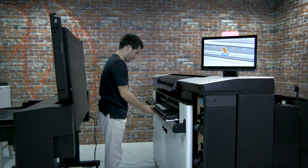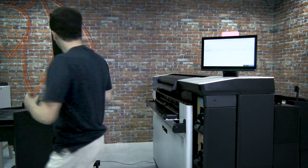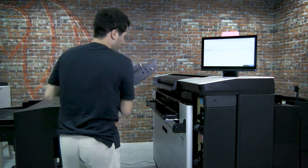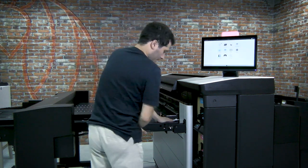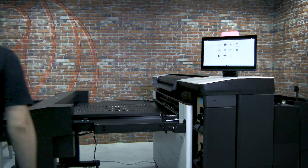Open the input tray and push the handle. Next, lower the Sheet Feeder's bridge and hook it to the printer. Lock the bridge to ensure the correct positioning and to avoid any movement while printing.